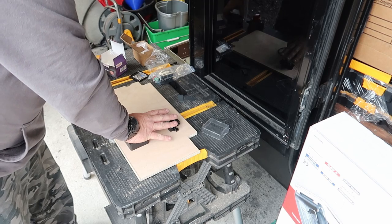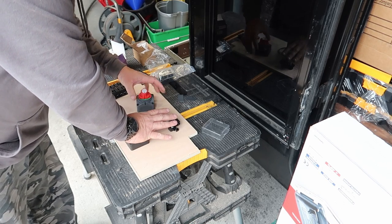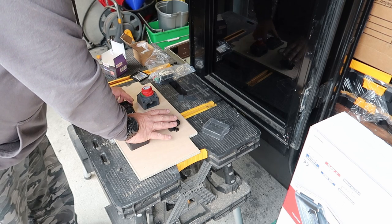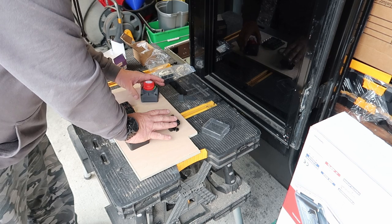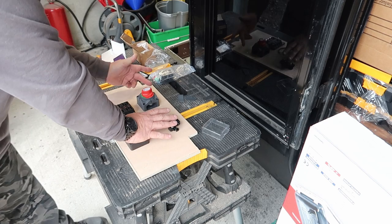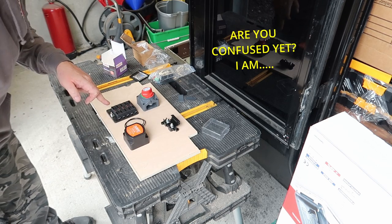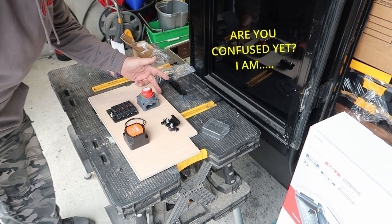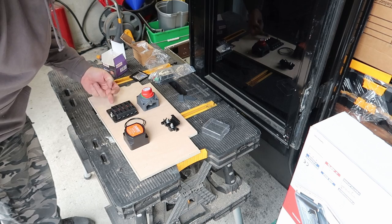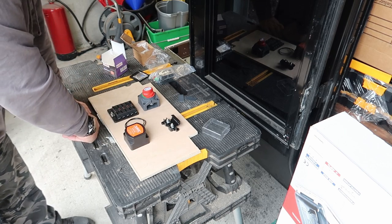Then will be coming off the battery through our isolator there, and then from our isolator, it will come out of the isolator through the back of the board and back through the front here to the, my hand was in the way then. So once it comes off the battery through this isolator, out through the isolator behind here and back through onto the fuse board, where then it distributes to all the items that we're going to plug into it.